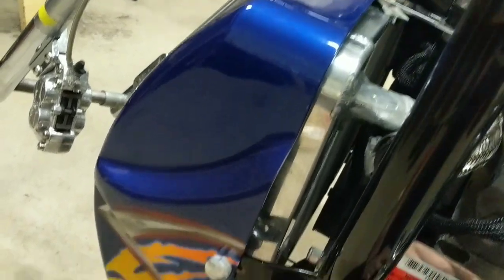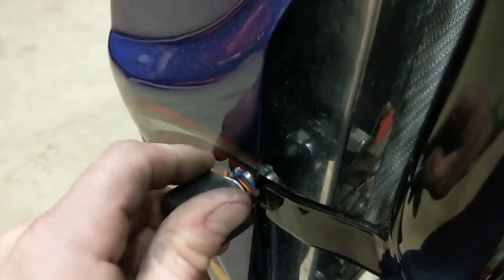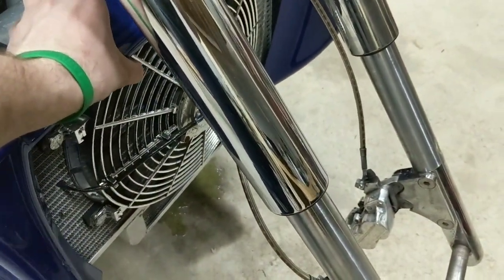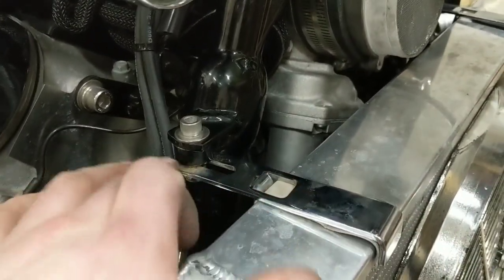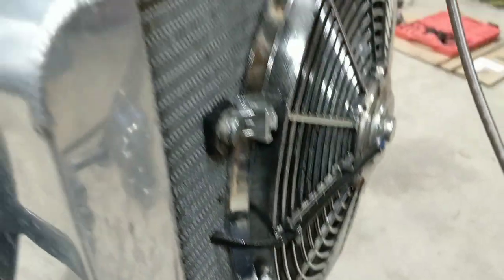Next we'll get the big radiator shroud out of the way. Now is the time you're going to need your special tool — these are a unique hourglass-shaped hardware. A 7/16 wrench gets the nut behind the bolt and you just twist it off. Once the hardware is out of both sides, get the forks re-centered for more room. Pull straight off gently, get the brake line out of the way, and the shroud simply comes off exposing the radiator. Then remove the upper radiator brackets — they're simple, just one through bolt each. The radiator just sits in a little cradle on the bottom, which makes it easy to get out.